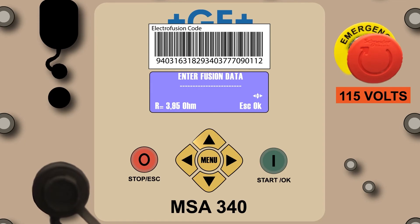Numbers are entered using the arrows on the keypad. The up arrow pressed once will produce a zero; pushed a second time on the same digit will produce a one. Subsequent presses will count through the remaining digits to nine, then repeat starting with zero. Pressing the down key on an empty blank will produce a zero, and subsequent presses will count down from nine to one, then repeat. Once the right number is in the correct digit, advance to the next blank digit to the right by pressing the right arrow. Continue this process until all 24 digits are completed. The operator must visually verify that the numbers of the barcode are correctly reflected on the screen. To change any numbers that don't match, simply repeatedly press the left arrow until the incorrect digit is underscored and replace it. Once the numbers are confirmed correct, press the green button.